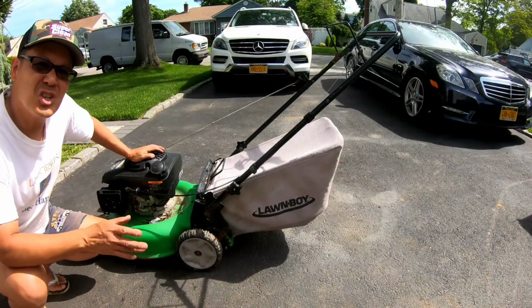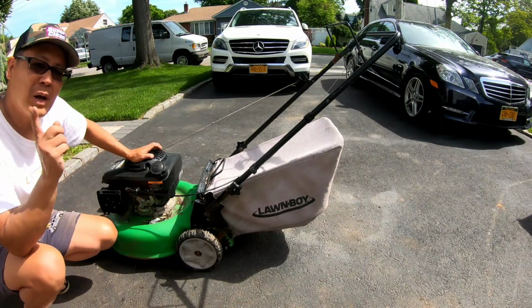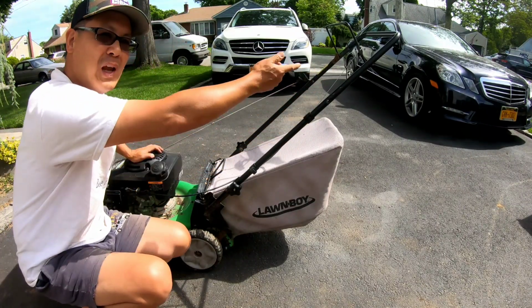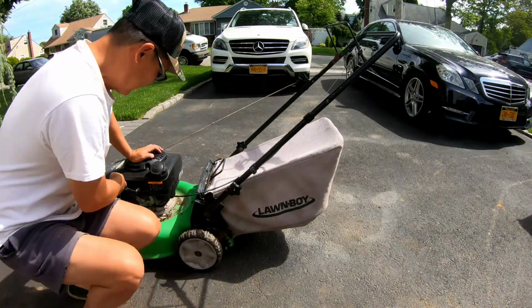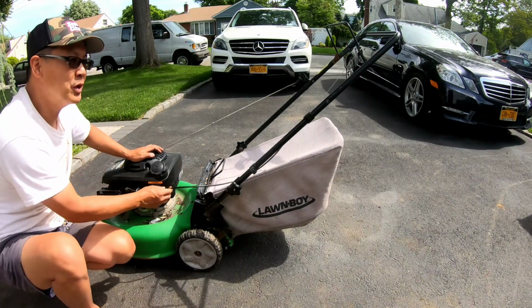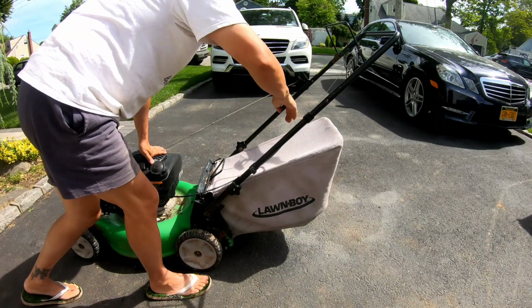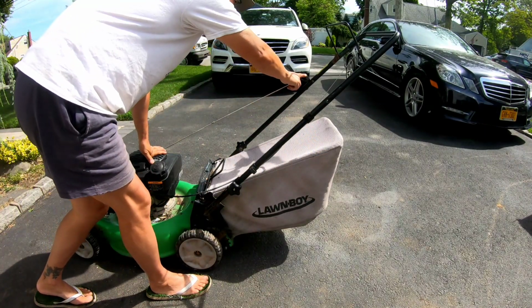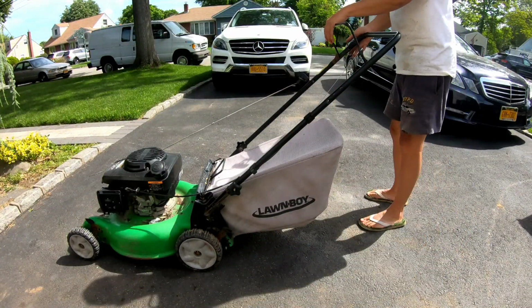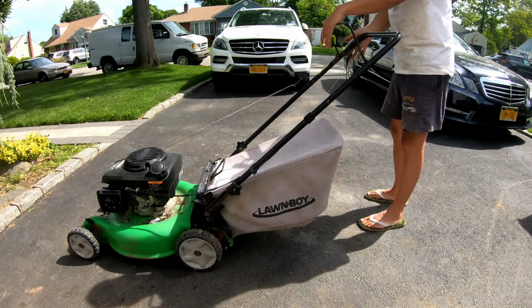So while you guys were just sitting on your asses watching TV, I got one of my new short cables, drilled a hole here after measuring how much play you had, right? To get this thing to disengage. So I have a new cable here, drilled a hole there, added one of these things so that this handle doesn't come back forward again from another handle. Put a handle on the pull rope and watch. Look at that, perfect. Got a disengage handle.